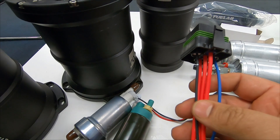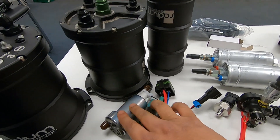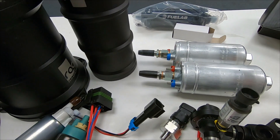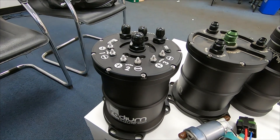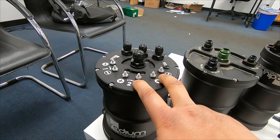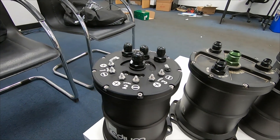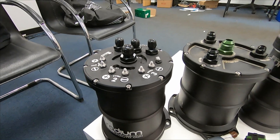You always want to do this because some of the stock lines do not support high amperage. The Walbro 450 is like 15 amps, and if you have two pumps running externally at wide open throttle you're seeing like 30 amps. Then unlike this one, we got two pumps in the stock tank and this surge tank has three pumps in it. So at wide open throttle at high boost with all three pumps on, you're looking at close to 70 amps — that's a lot of current being drawn. Luckily, this car has the electrical system for it, so we're not worried.